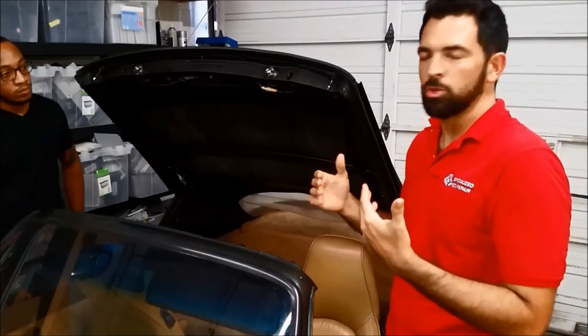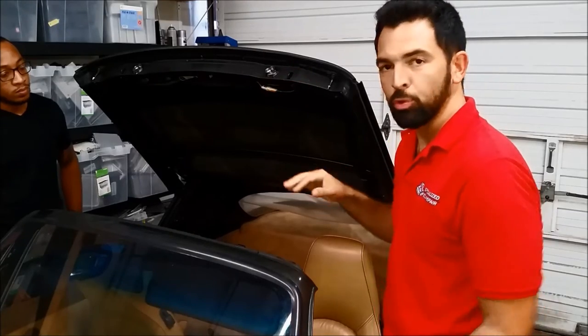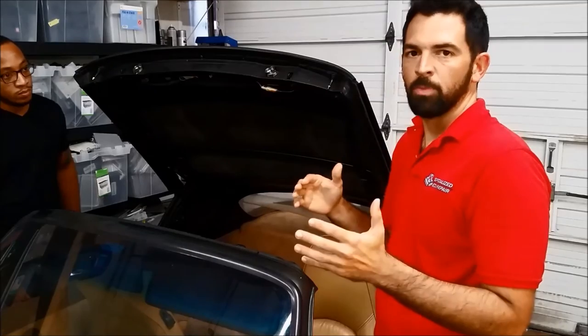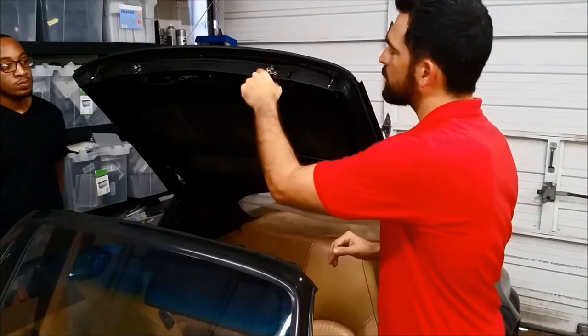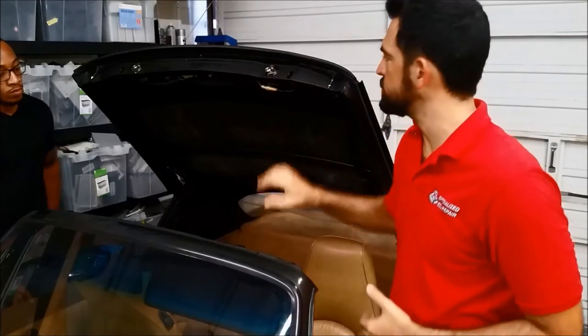The test we're going to do is to hold these micro switches and then press the switch on the dash of the car to close the top. That's going to confuse the convertible top unit into thinking that it's already closed, and therefore what we want to see are these two micro switches completely closing — that way we know they are registering what's happening and they also reach completely closed position.